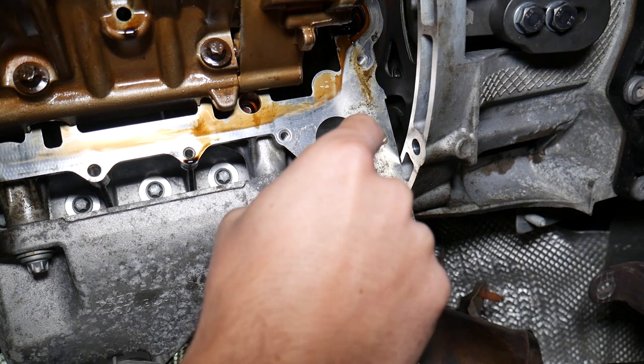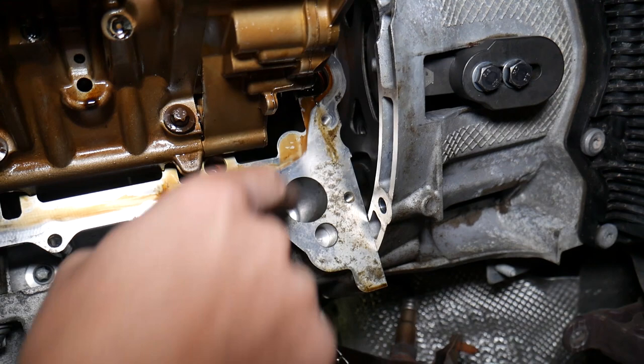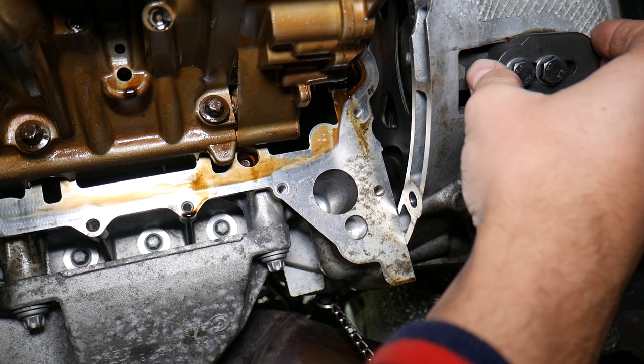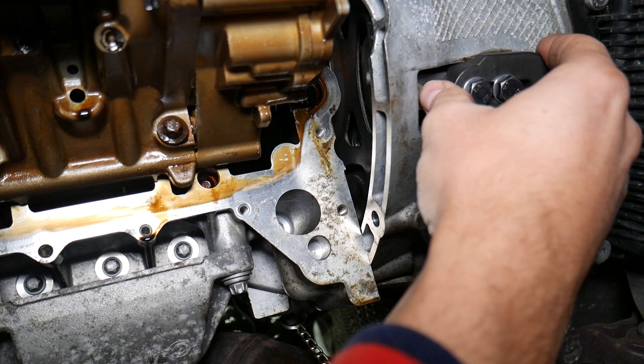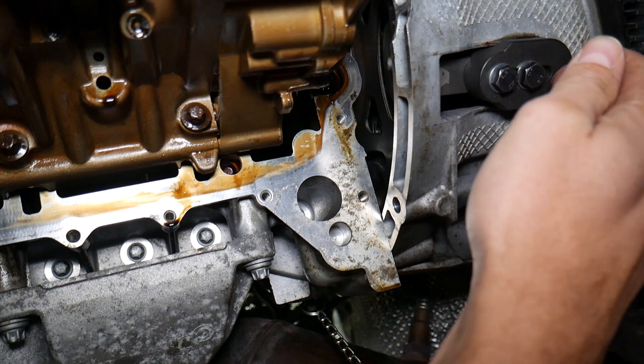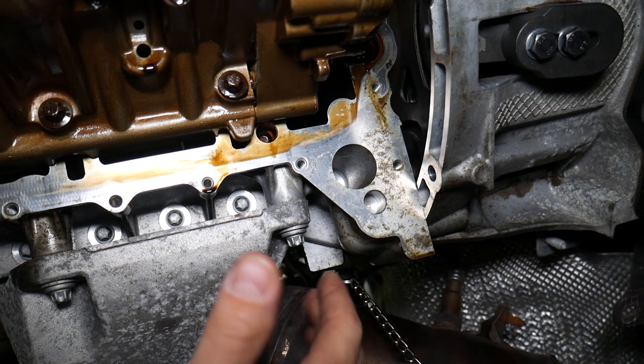What I do is pull the pin out, make sure it's at TDC, hold that flywheel holder tool really good, and have a person on top start taking the bolt off. Make sure the teeth are all the way in the flywheel — you can see that through here. Also make sure the car is secured on jack stands, because when somebody starts taking that bolt off it will be really tight and will shake the whole car. You don't want the car to fall on you. Use eye protection and gloves, and make sure you don't pinch your fingers. With the pin out, we get the bolt loose on top with the big pipe, then I verify it's at TDC and push the pin back in so it doesn't move.